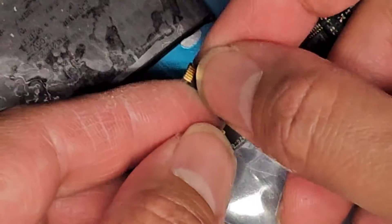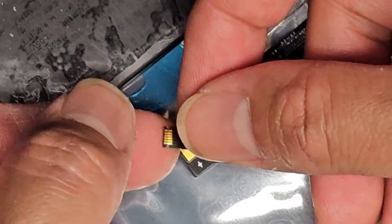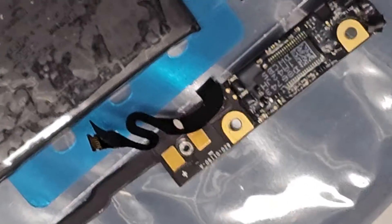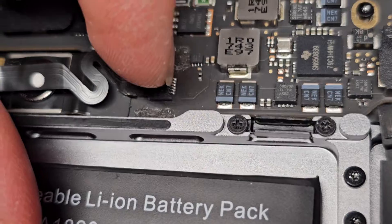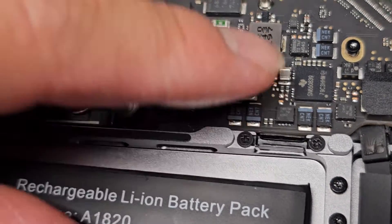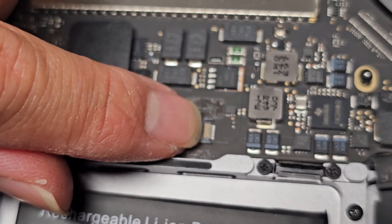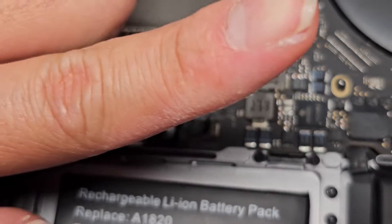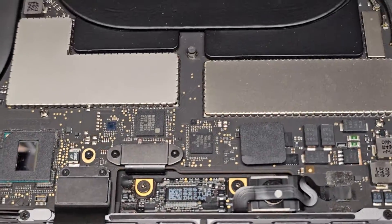If you look at the top, you can't really see any change, and that's what you want. Now when you slide this cable in, because it's thicker — let me show you on the computer — now that the cable's thicker and the tab is missing, it basically pushes the connector up, pushing the pins up against the pins inside. Normally the plastic would rock and make it go the other way so the pins would push down. And that's how you fix that. Without this fix, the MacBook won't even charge.